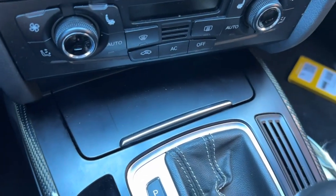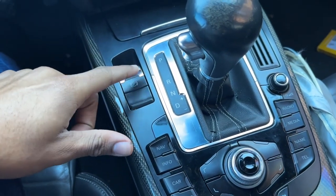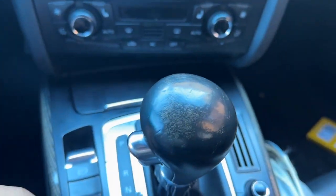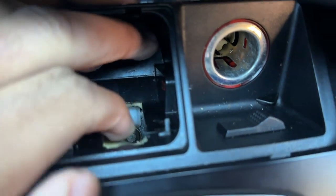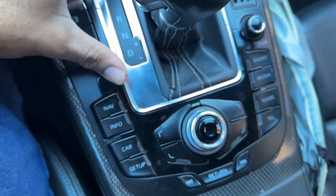What I've done so far is put the car into neutral, and then make sure your parking brake is also on so you don't go rolling backwards. You can start the car off to put it in neutral, or just go in here, take out the ashtray — there's a little button right there, just push that down with a screwdriver and then throw the car into neutral.